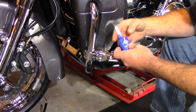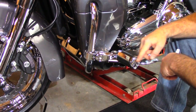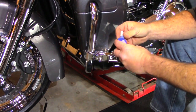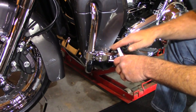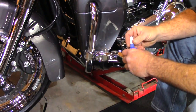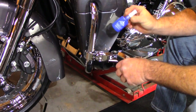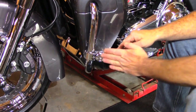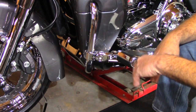I'm going to go ahead and tighten it down. One thing I want to note: I actually put a little bit of Loctite Blue on this bolt and the bolt that holds the foot peg in too. It's just a good idea — the Loctite Blue is easily removed if you need to take these out, but it's going to hold them a lot tighter. Most bigger bikes have some vibration to them, so it's always a good idea to throw some Loctite on there. You can pick up a bottle pretty cheap and it lasts a long time.